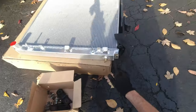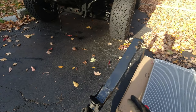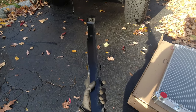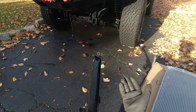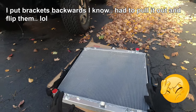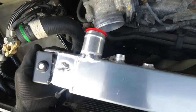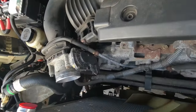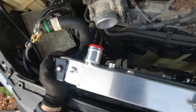The only thing was that I had to open up these brackets because the radiator is wider, so it can fit over this. But other than that, so far everything looks okay. I somewhat tried to clean and refurbish these brackets. Of course you could buy new ones, but they're like $150 for two of them. All I did was sand them off and paint-spray them — they're still good. The brackets are in place, so now carefully gonna put the radiator in place and start securing it. Take your time and be careful with it.